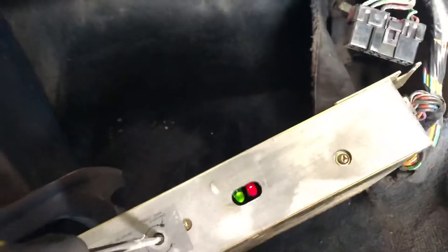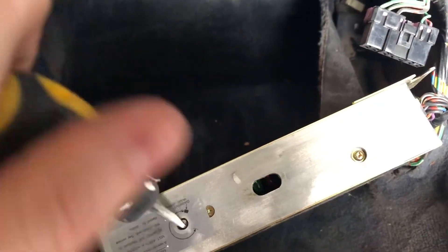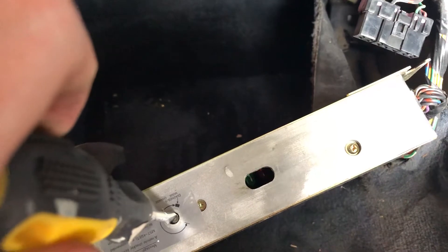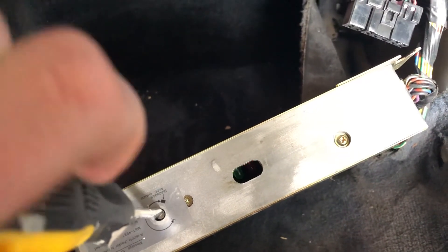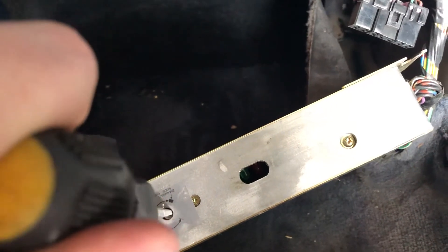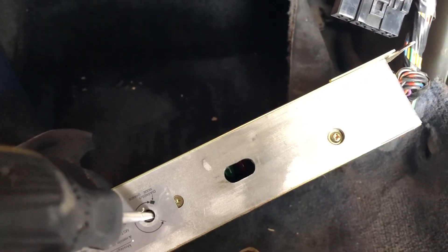The thing that differs here from the other versions of the vehicle is that you can't just turn it on and have it go. You've got to wait for three consecutive blinking lights together right there, turn it directly off, and after a moment, you'll get your codes.